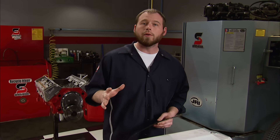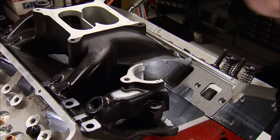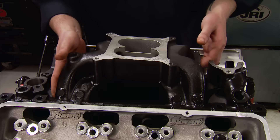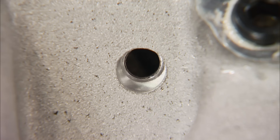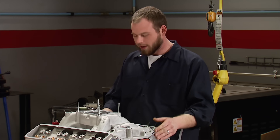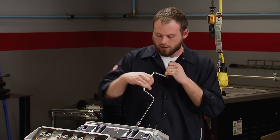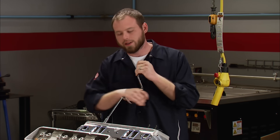When you're going for those big horsepower numbers, that time can be well worth it. But you could still be leaving a lot of power on the table if you don't fit that intake to the heads. I cut away an intake manifold to show you what improper runner alignment looks like — this will cause turbulence and can cost big horsepower. You can check yours by lining up the bolt holes. If they don't line up, you can correct it by adding an extra gasket to raise it, a thinner gasket to lower it, or in extreme cases having the intake milled. Elongating the bolt holes might get it to fit, but that misaligned runner can cost anywhere from 20 to 50 horsepower.